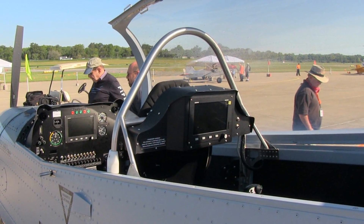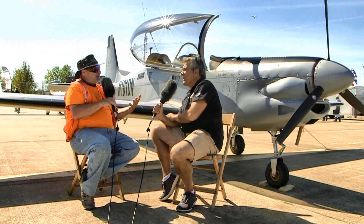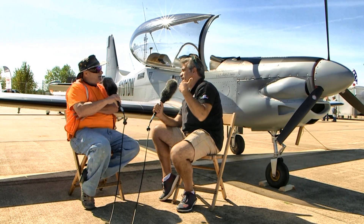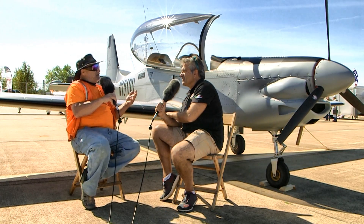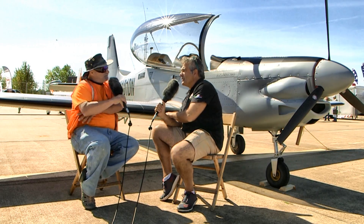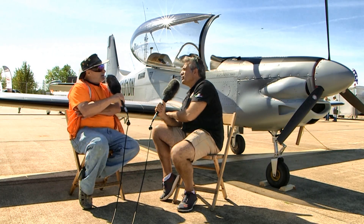The experimental allows us to go a little bit faster and increase the maximum gross weight. What type of kit is it? It's an all-metal construction. The only fiberglass part will be the cowling in the front; other than that it's all metal. The construction type — is it a match hole? Yes, it's pre-drilled and then you put it together, drill it to size, and put the pop rivet in.